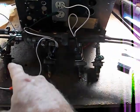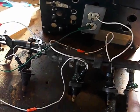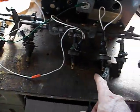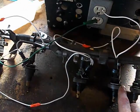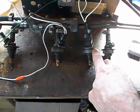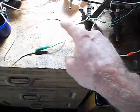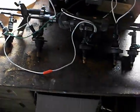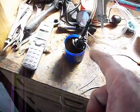When I first turned it on in series, the very first injector was fine — just clicking away, humming, sounded great. The rest of these are stone-dead quiet. About 10 minutes into the process, this second one came on board — just opened up and started humming away. These four are still dead, and I'm hoping that just running them, maybe the vibration from the electromagnet inside might break them free.